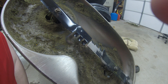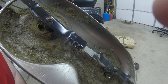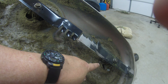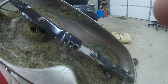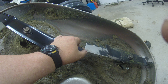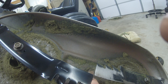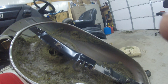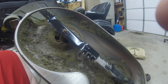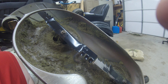Basically, whenever you're doing lawn service and you're having uneven mowing, first thing you want to check is get your deck off and make sure that your two blades line up to each other — they should be even across. If one of them is sticking up above the other one, it's going to scalp all day long. I've got this within a very close tolerance — it shouldn't scalp anymore, it should do a good even mowing. Anyway, I'm going to go ahead and flip her over and put a new belt on it since I'm in here. That hub was a lot of fun — not so much the hub itself as getting it back straight. Anyway, it's my fault; I'm the one that drove it up on a railroad tie.